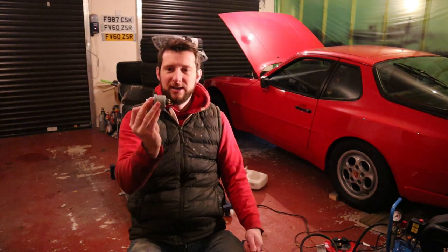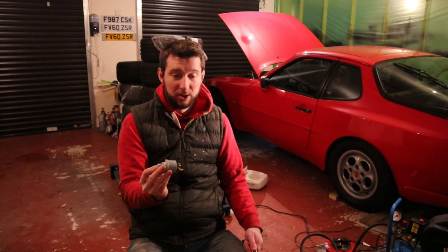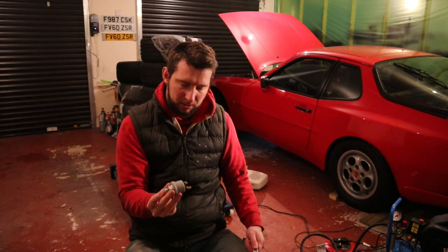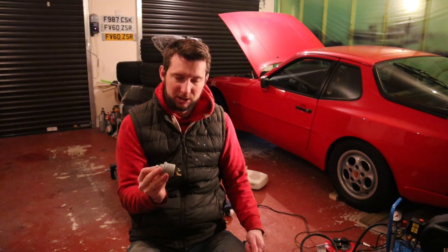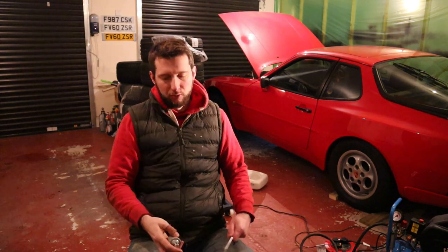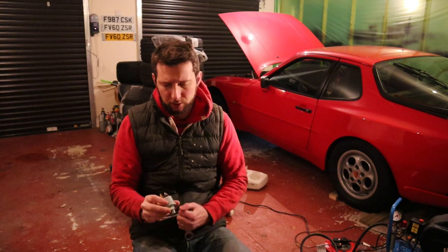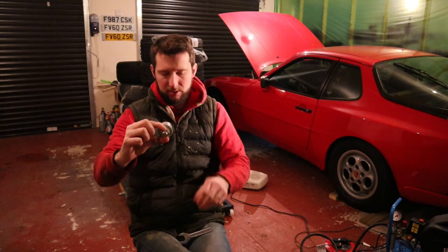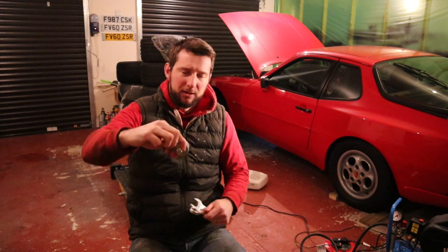The challenge with this little fella is where it sits — it's in a bit of the engine that's really quite tricky to get to. It sits underneath the oil filter and above the power steering pump. The way you should really try and take it out is by either taking the power steering pump off or dropping it down and getting in with a crow's foot onto the side of it. It's a 24mm nut. You can also try coming in by taking the driver's side wheel off and breaking it off that way.